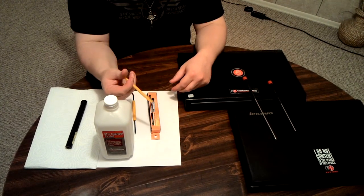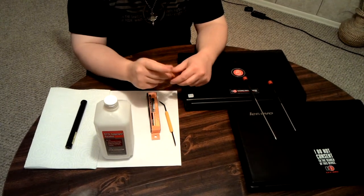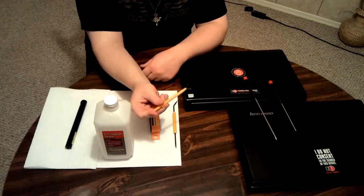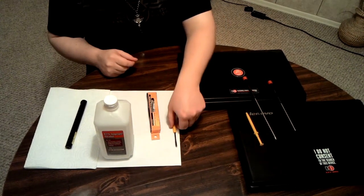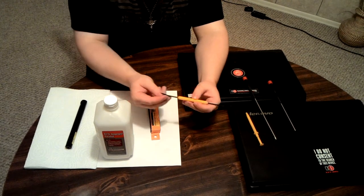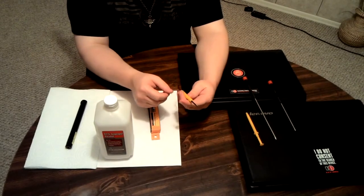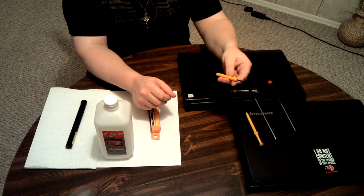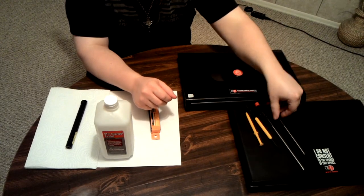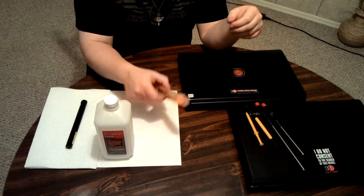And I recommend getting one of these so that you can pick stuff up. So if you drop a screw down in between a couple of chips, you don't want to go shaking it around and risk damaging something. You'll just reach in and pick it up. So this is very useful. Another tool that you'll need, and I'll tell you which laptop is the one that needs it, is one of these, either a sharp point or sharp edge, mainly to pry something up, because certain laptops require that. It's just their way of making people not be able to disassemble their systems on their own as easily as possible. Certain manufacturers shy away from that method. Others don't. You need your thermal paste, of course.